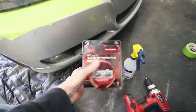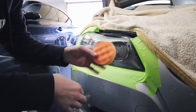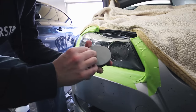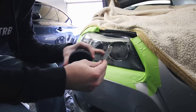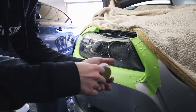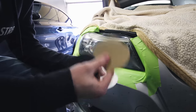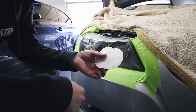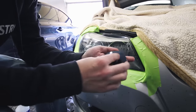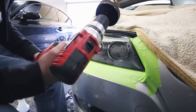So I just do two layers of tape all the way around — two wide and two deep. Doesn't hurt to go overboard with the tape. I've also laid a blanket over the engine bay so water and splatter doesn't get up in there. Now we're ready to go ahead with the first step of the actual 3M process. Once you open the package you'll see a couple different things: the orange pad and the drill attachment with a special sanding foam disc — set those aside for now. You'll have two different color sanding pads: gold ones for step one and white ones for step two.